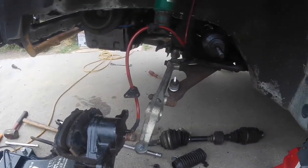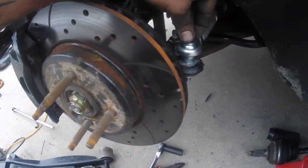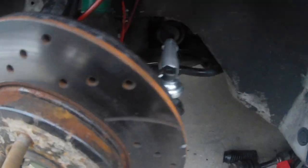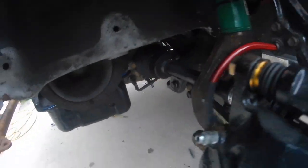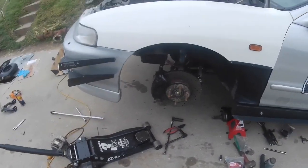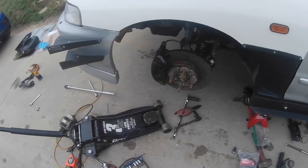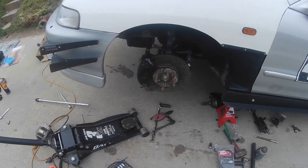I don't think I want to get it all done tonight because I haven't even touched the other side yet. I finally got everything back together — I'm not sure how the alignment is, but I guess we'll find out tomorrow. I put a lot of anti-seize anywhere where any sphericals go because it's aluminum into steel. Got the control arms in, new axle in, new alternator — so that's it for now. I still have to do the spark plugs and the complete other side tomorrow.